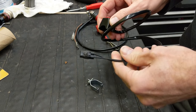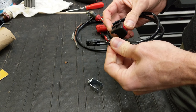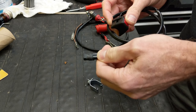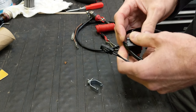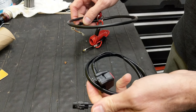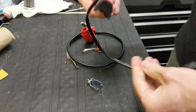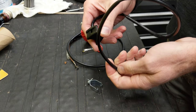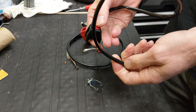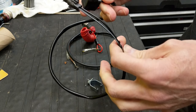If you get a stock kill switch, I wanted to use a different one from the manufacturer or the one that came with the bike, because if I mess things up I still want to be running tomorrow, so I want to keep that working switch in good order. Plus, I want to be able to rig this up, pull it off for the summer, and put the whole setup back on — so I wanted a separate kill switch. The Yamaha uses a normally open switch. Other bikes use normally closed, so you've got to make sure you know which one yours is. This one is normally open — I tested it, it works, it killed the bike.